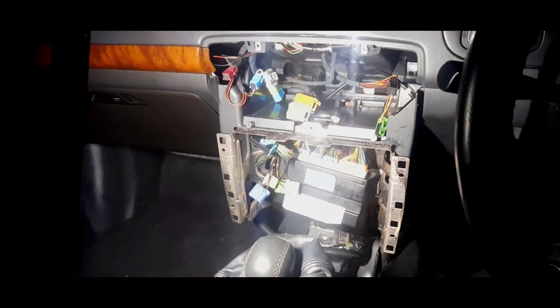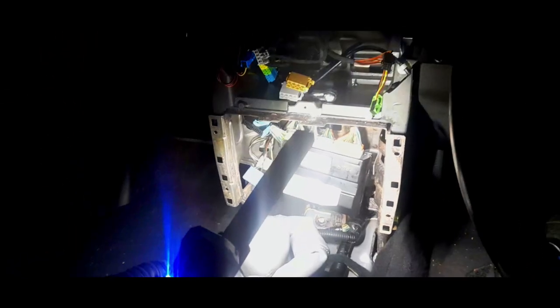What the hell? And even better still, turn that off, wash wipe. Oh, it works on that as well. What the hell? We've had a victory here, but I don't know why. I must have done something right. I mean, I just cleaned the wiper out, and this is probably just a lesson. If anybody's watching this video and who's having the same issues as me, I would suggest you clean that. You clean the connections, yeah, check the relays work, but clean the wiper motor.